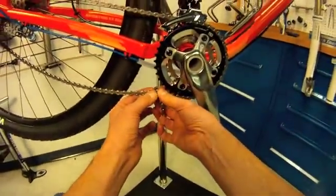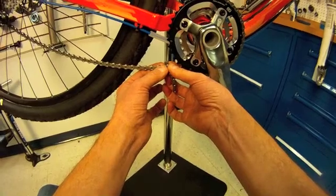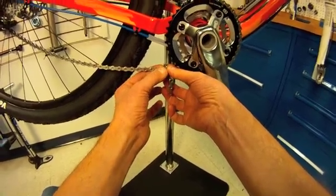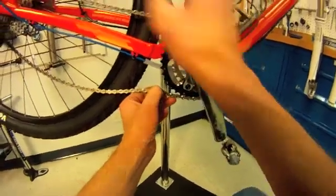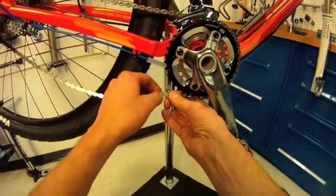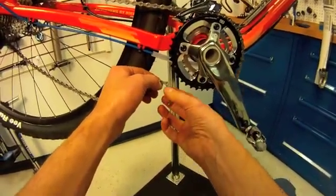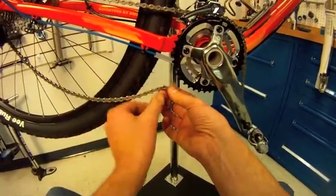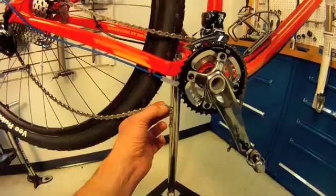That's an additional inch and that gives us enough bend in our rear mechanism to allow that shift. We do want to allow that combination so we don't damage things. If we do get in that gear — this is the 2x10 system and that certainly is a gear we might be using. So right there, we're going to cut off one, two, three — that fourth one right there. That's where we're going to shorten this chain.